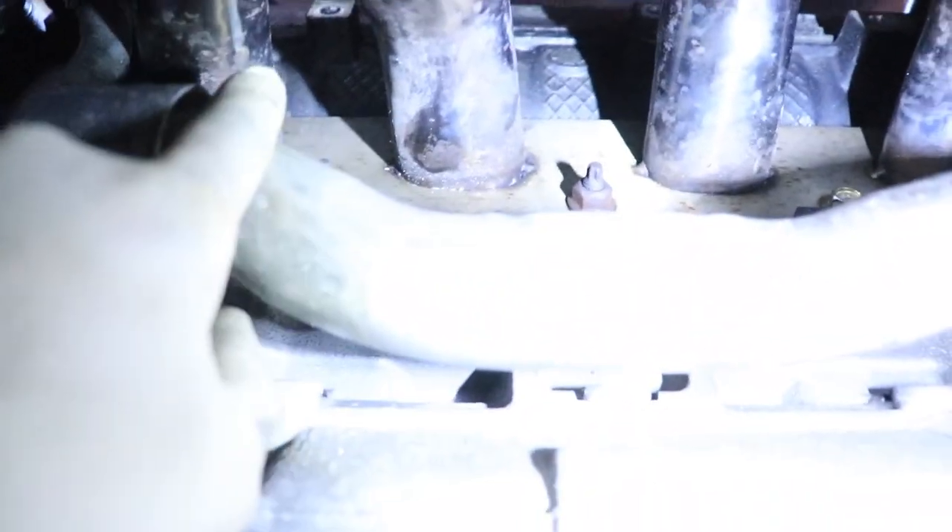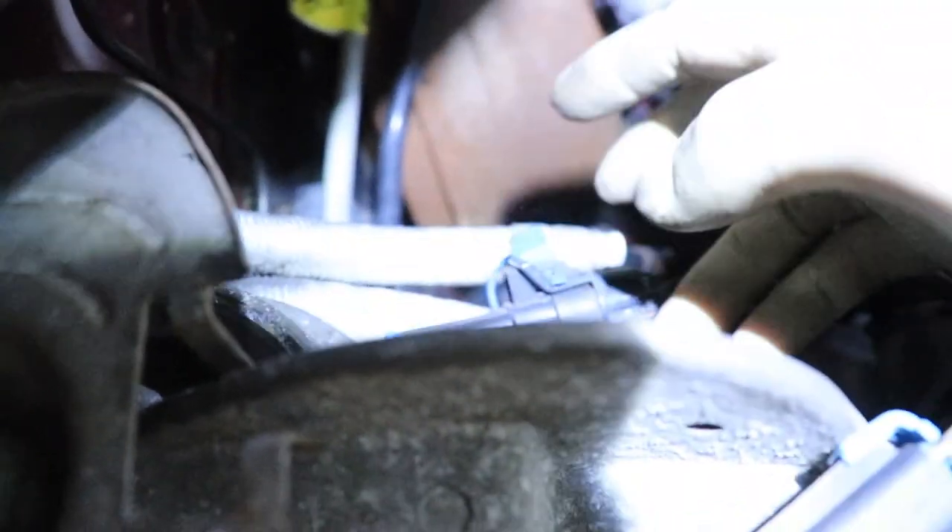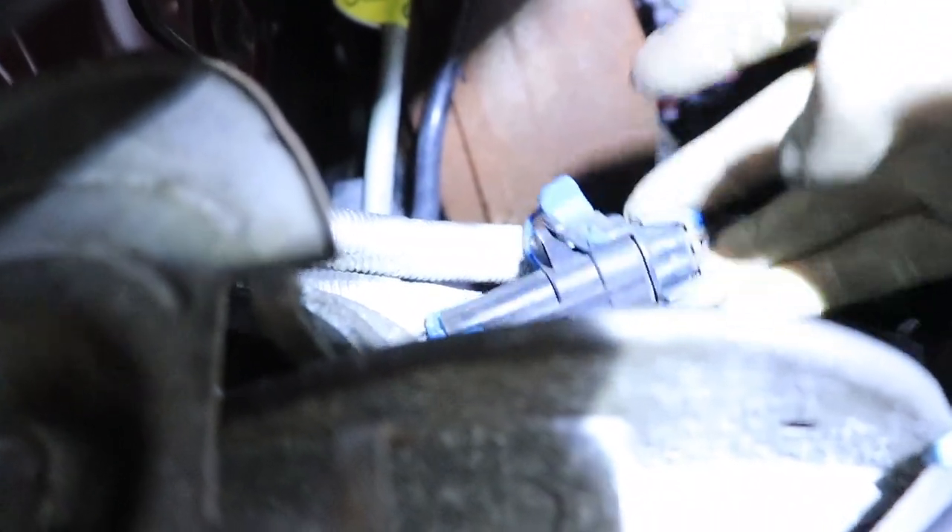We got all the bolts at least tight to the flange. One thing I wanted to explain: taking it off I don't care what order, but when tightening down I go center-out so that it mats the gasket down and kind of pulls it out as you tighten to give it the best seal. As far as the oxygen sensor goes, I had to reroute it a little bit — usually it went right in between here, but now I'm stretching the wire because the point at which the oxygen sensor sits on the header is further back. So I put it up here and around the outside. Don't forget to put your clip in to make sure it stays and won't come undone. I'm going to tighten up these bolts here first and go from there.